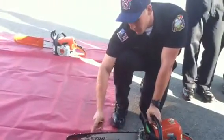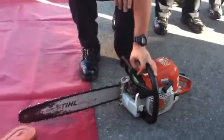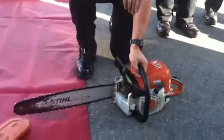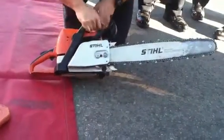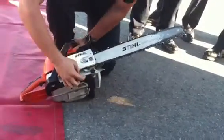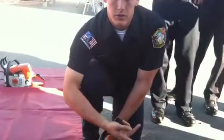Working your way back, that's your bumper spike — used in the logging industry, something the fire academy really isn't going to be dealing with. This is your front handle guard and this is your front handle. The front handle guard not only serves as a front handle, but it's also your chain brake. Right below it is your muffler. Right here is your chain tensioning — the general rule is a dime's distance between your bar and your drive links. And right here is your oil-o-matic chain adjuster, which limits the amount of oil going to your guide bar. To the left, more; to the right, less.